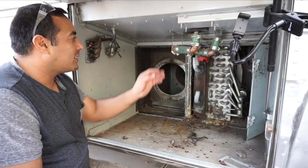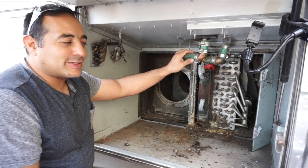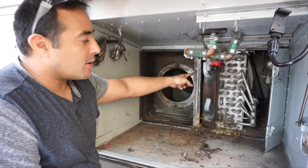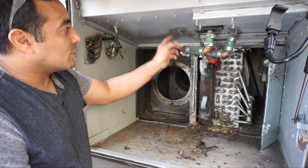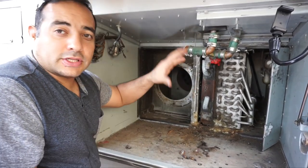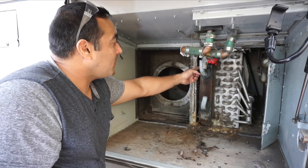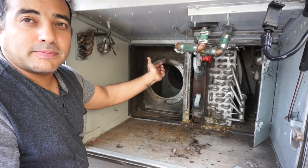Okay, so we got this door out. I've researched more about what these things do. There was a supplementary pump that hooked up to these pipes here that helped it go. This is a heater core to heat the inside. So the water comes from the engine in the back through here. Then a supplementary pump would force it into this radiator heat core. Then it would come up here, and this is a return line back to the back of the bus,